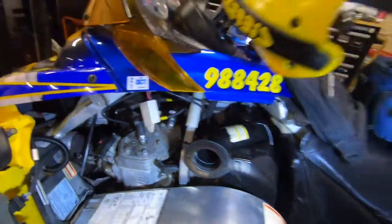If you have an SDI you need this box, otherwise for '05 and older sleds you need the temperature sender probe. For '06 and newer, I'm pretty sure on all models you can just plug it in like this, but contact your dealer to confirm. I just wanted to show where it was on the harness because a lot of guys were having trouble finding it.